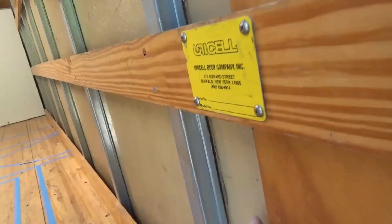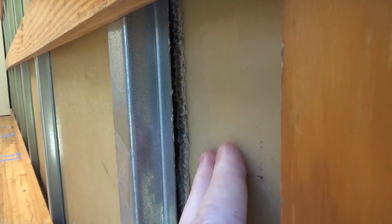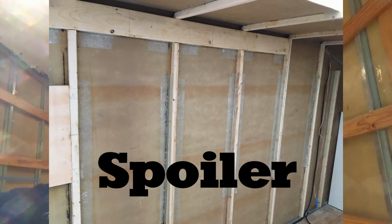We're going to do some demolition. We're going to start by removing this overhead door, then all of the wood and the steel framing. Now the reason I'm removing the steel framing is it's becoming unattached from the fiberglass shell. For me to be able to attach wall and ceiling panels, I need a very strong and sturdy base to build off of. So we're going to take this out and replace it with fiberglass reinforced 2x2s. That'll give us a nice strong straight structure to start with, and then everything else we'll be able to build off of really well. So let's get started on that.